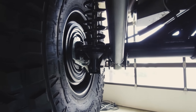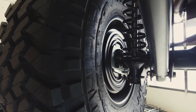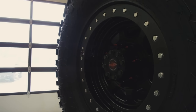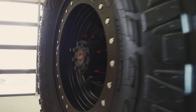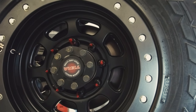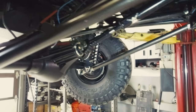On a JK with semi-float, even with aftermarket shafts, you'll bend the flange if you really beat on them — then you're driving down the road and you hear that whoosh-whoosh because it's rubbing against your brakes. But on a full-float, you have to work insanely hard to bend the spindle. Full-floats are super cool. You can actually put a lockout here with a double-spline axle shaft — they make Dana 60 lockouts, so you could have rear lockouts if you wanted.